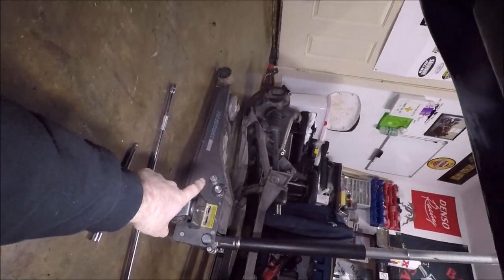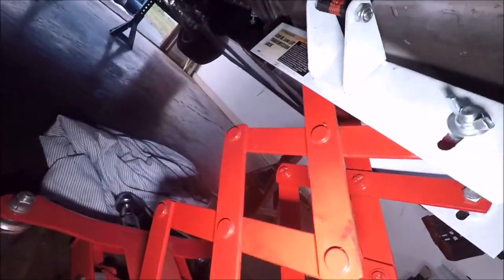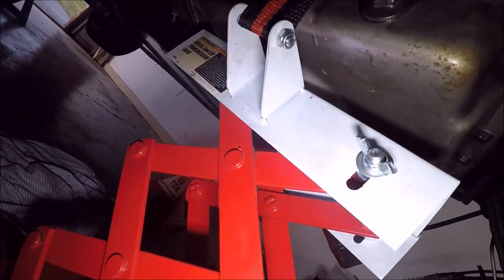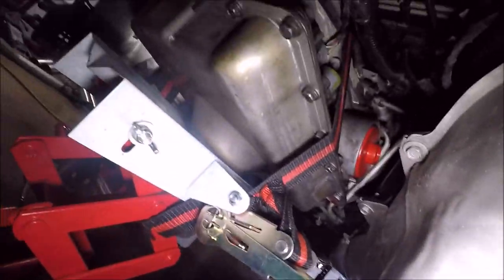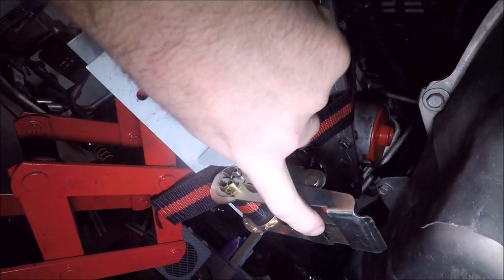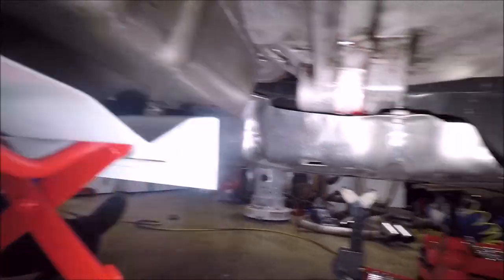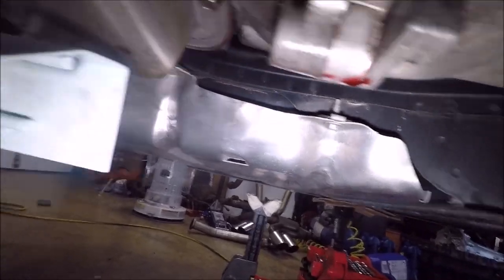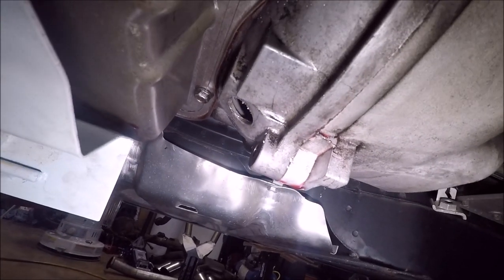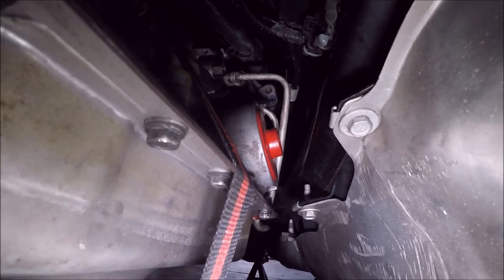I pulled my other jack out from underneath the cradle and put it under the rear end so I could move my transmission jack back under the pan. Because of the hump in this pan there will be a little wobble, but it does fit down in the crease of the transmission jack a little, and I strapped it down as tight as I could. Don't forget about the bolt on the very bottom — it goes in from the back side, the exact opposite way of all the other bolts. It would be easy to forget about, and it would suck to snap that area off your bell housing. Should be ready to separate it and lower this thing down.